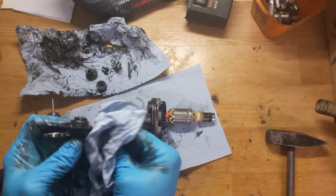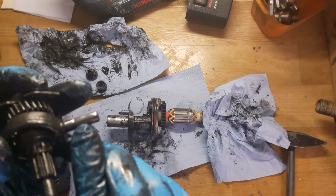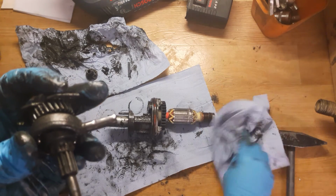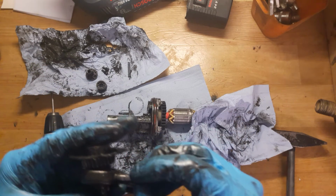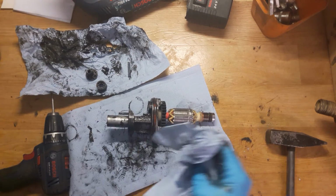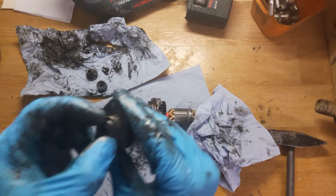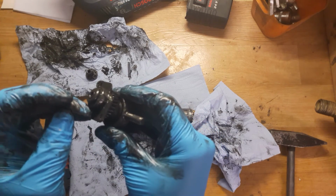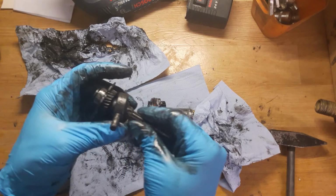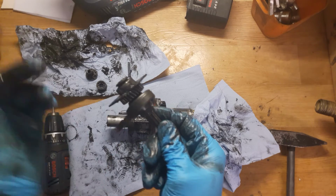Okay, now the SWASH bearing, you need to check this part of it. It's really hard to damage it. It must be like here. It's just round, nice. Now you have dents, so it's worn out. You need to replace it. If you need to remove other parts, first of all you need to remove this magnet, then the ball bearing, of course, then this plate. It's a flat washer inside. Then remove the gear and the SWASH bearing will go out, of course, or you can see that in other videos of mine.